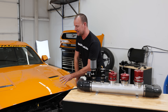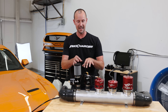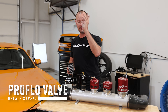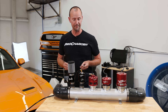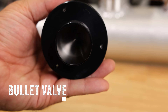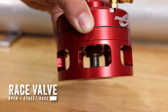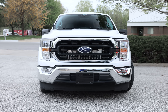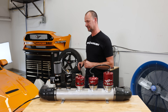To start off the sound testing, I'm going to lower the hood to minimize engine noise and really focus on the sounds the valves are making. We're going to run this ProFlow valve first in the configuration wide open, venting to atmosphere just like a normal blow-off valve. Then we'll add the filter muffler, which cuts down the sound a little bit. We'll move on to the bullet valve — bet any money it's got a little more of a wooshy whistle noise. Then we'll go with the tried-and-true race valve — almost everyone on the internet has heard someone doing a big wooshah with one of these. Then we're going to do all three at the same time and hopefully not blow the mic stand out of the way.